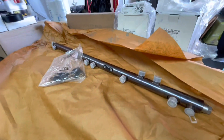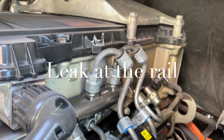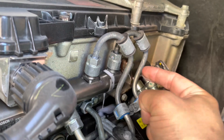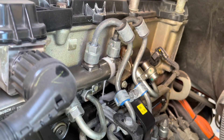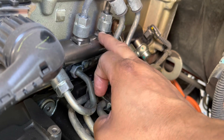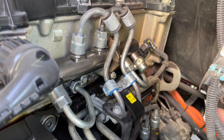We are going to prime the fuel system. I didn't bring the GoPro, so it's a bit of an epic fail on my part, but I'll show you what you can do either way. Here you're going to see the actual leak at the common rail and not at the high pressure line. Keep in mind, if it were the line, the pressure would be a lot more. You can see the fuel is actually coming up from the bottom and not from the top. If it were from the top, you'd get fuel streaming out, literally spraying at high velocity. In this case, that's not what we have.